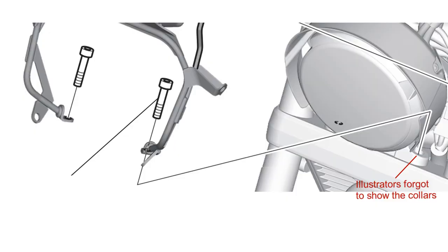Line up the right and left screw holes on the bottom of the stay with the two collars you placed earlier. If you tape the collars in place, remove the tape first. When you have the bottom screw holes lined up with the holes in the two collars, insert the 8x40mm socket bolts and start the threads.